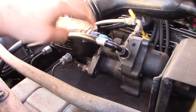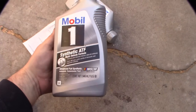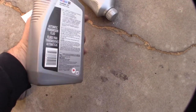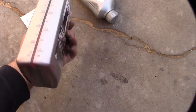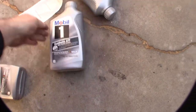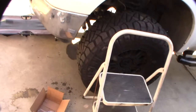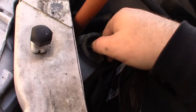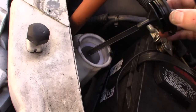The original spec on the 2006 Power Stroke was Mercon V, but it's kind of hard to find a full synthetic, so Mobil 1 supersedes that. You want to use synthetic just because I've never changed the fluid in this truck and I've had it for seven years. The color is orange, so it's definitely pretty old — that's why you want to use synthetic, because you don't flush or change this thing very often.